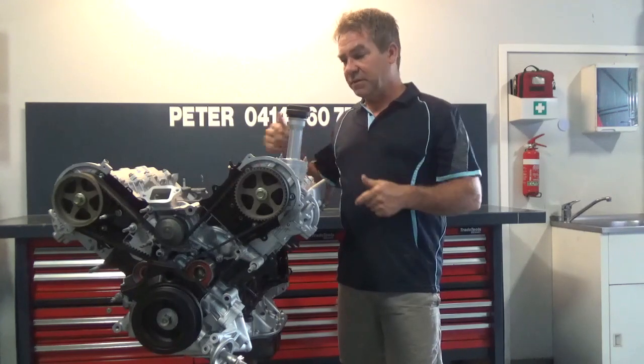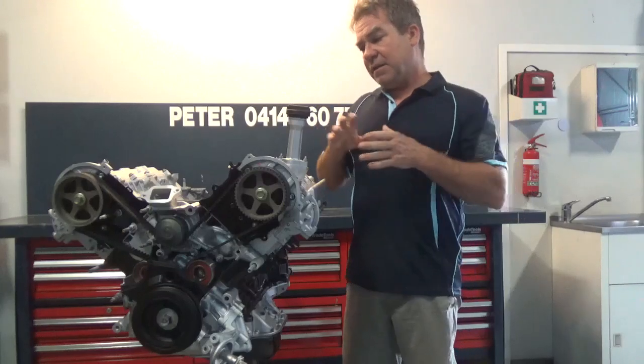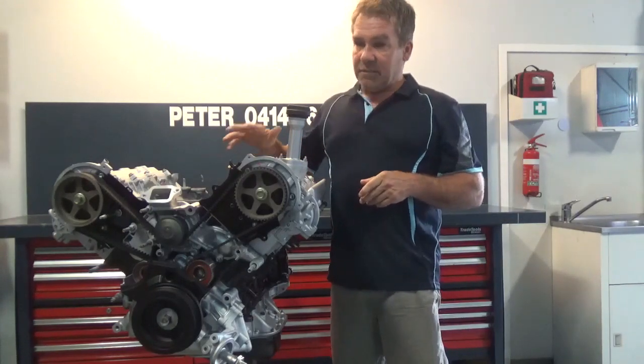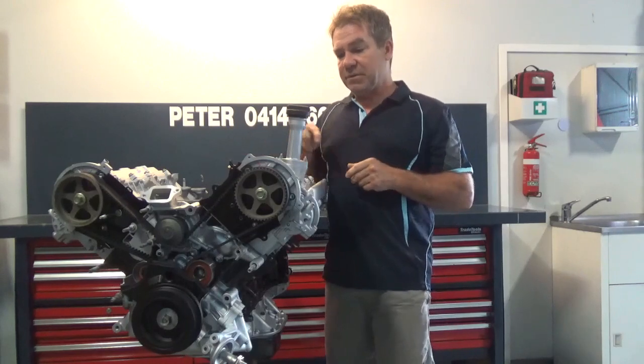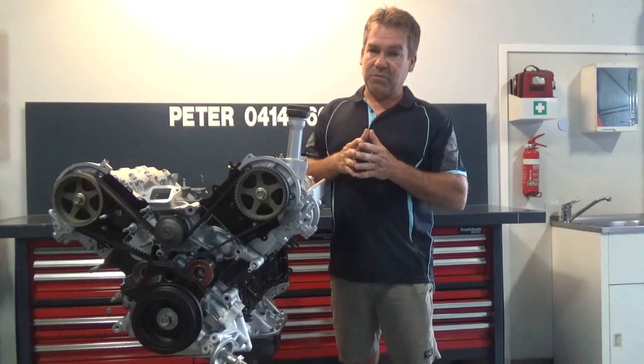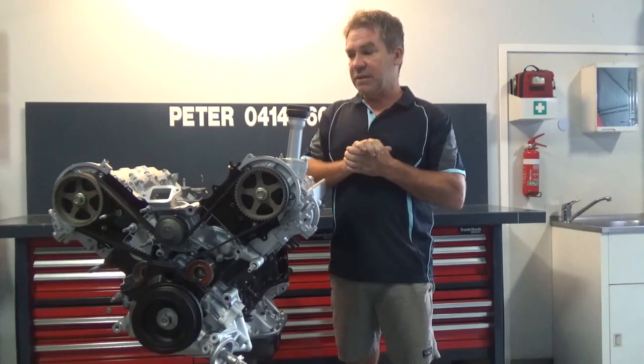The 200 series are a little bit different — the block has different oil galleries, variable cam timing, that sort of thing, so they are a lot different. With these, a couple of big issues. The main reason we do them is LPG and gas. Toyota as a rule don't really like LPG on the back of its valves, so we do a lot because of that reason.